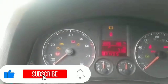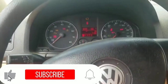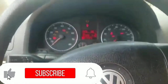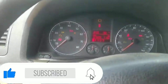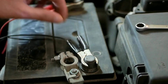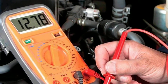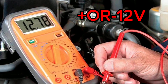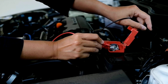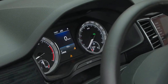To solve this issue and make your steering run smooth again, pay attention to the following. One: check steering assist power supply terminal 15. Terminal 15 in most cars is simply battery power when the car is switched on — it should reference plus 12V. Use your multimeter to trace it among the wires that go to the power assisted steering system with the engine on.